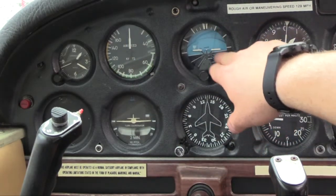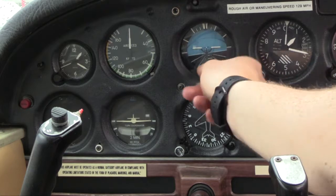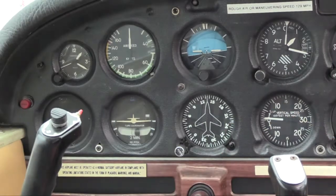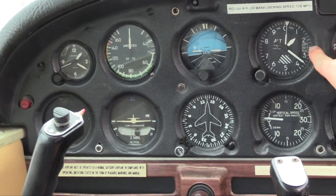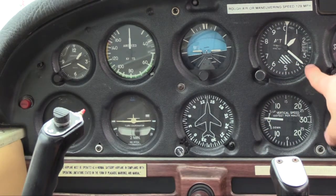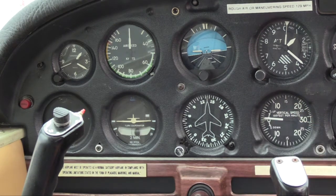Look at your airspeed — that should be on zero. Over here is your attitude indicator; right now it's lopsided but it would be straight with the vacuum pump running. Make sure that the little airplane is on the artificial horizon, and rotate the knob to adjust the height — once it's set, do not touch it in flight. Here you're setting your field elevation on the altimeter. The altimeter reads 30.12, so we set it to 30.12 — within 75 feet of field elevation is the check. Your vertical speed indicator should be at zero; this one's showing about 100, so we'll make that our new zero.